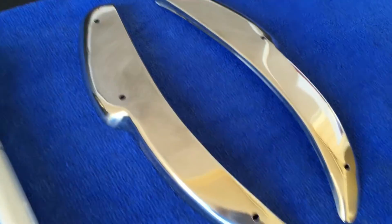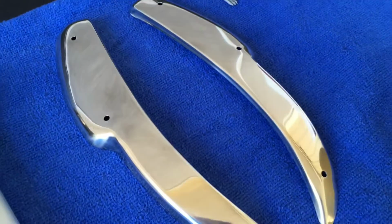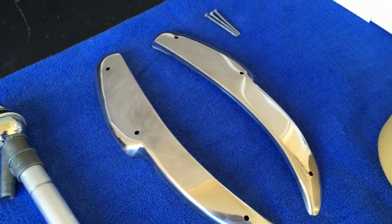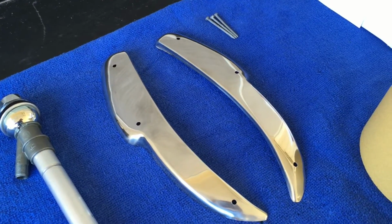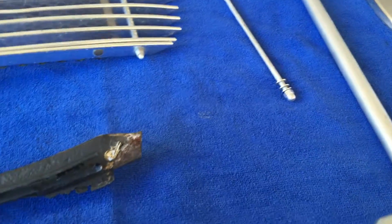Also, bumper caps. You want to make sure your holes fit your end caps. In this case, these ones did. These were real nice quality reproductions, and they fit pretty good. Although most of the parts you're going to buy are not going to fit. Probably going to have some adjusting to do, some other things to do on the car to make up for it. But play with it enough, you'll be able to get it.